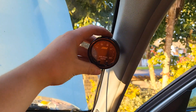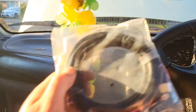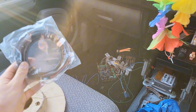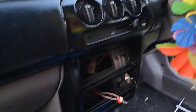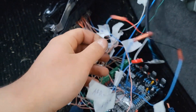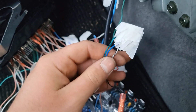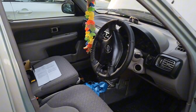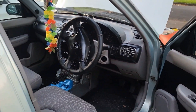Eventually I want to mount the gauge here and that's going to look mint, but that's the least of my worries right now because my car doesn't even run. From the AFR gauge we need to run a cable all the way back down into the ECU — that's actually going to be the signal for the air-fuel ratio. I was a bit wrong about that: you actually need to run 12 volts, ground, and then AFR negative and AFR positive. There are more wires in the loom the gauge came with but they're optional, so we're not going to use them. Right, so that is all the wiring for the ECU, the AFR gauge, and the igniter — all of it done.